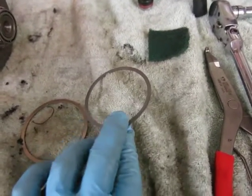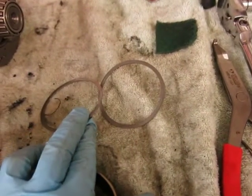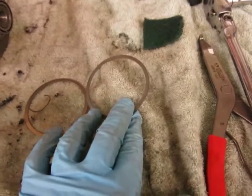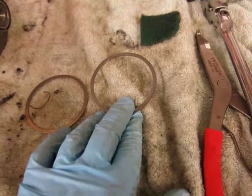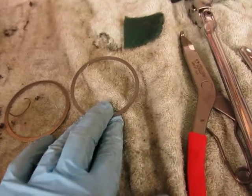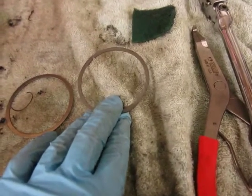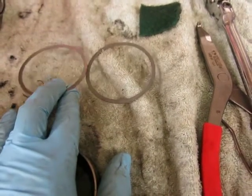In the shim stack that came with the kit, I had one 34.5 mil thick shim and one 31.5 mil thick shim. The 34.5 mil would technically give me half a mil of preload, which is outside the recommended range. Even though some people drive it a little tighter, I'm not sure I want to go to the preload side, so I'm going to go with the 31.5 mil shim, put it back together, and see where it sits.